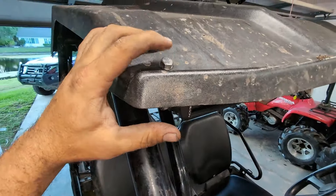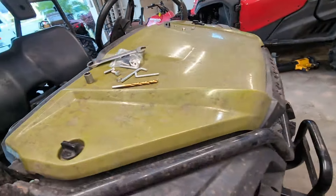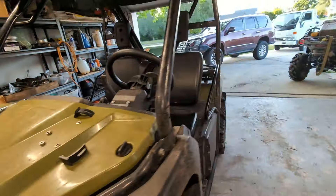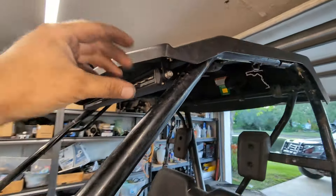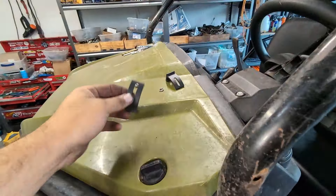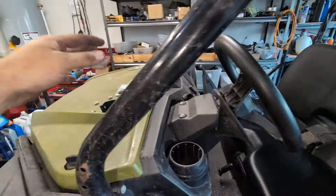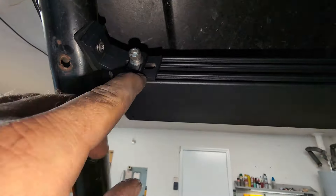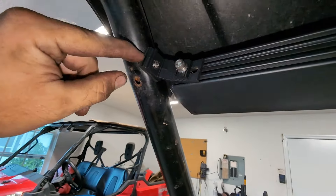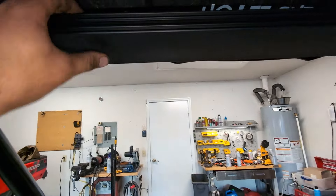I first drilled two holes in the roof and mounted it to the roof — that was pretty stout — but it came with a bunch of really nice mounts. I just wanted to find a way to utilize some other ones. The first mount is just an L bracket mount. I mounted that on there and got it adjusted where I wanted. It also comes with four curved mounts with a nut that goes in a slot. I put a self tapper into the roll cage and then into the light, and now it's on really good. It actually reinforced the roof.